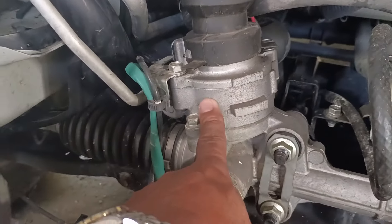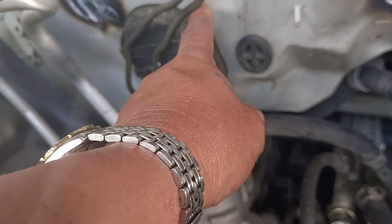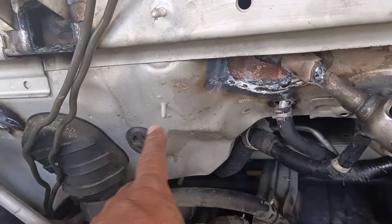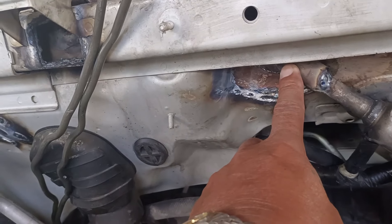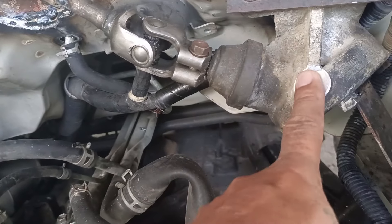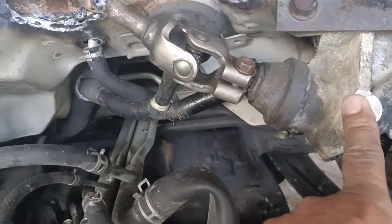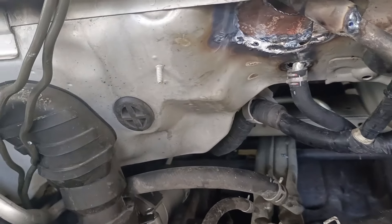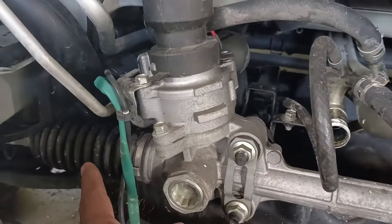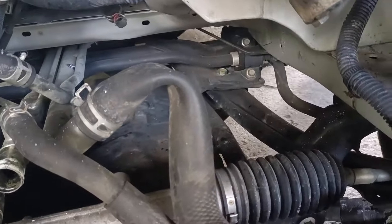So from the right-hand drive, a secondary gearbox was added inside. There's the connection here. We'll look inside now so you can see this connection. Inside, there's one secondary gearbox going out to the exterior — another secondary gearbox going to the left-hand drive. This conversion is complete — this is what's called 'baki-baki.' The original rack and pinion is still there, untouched, so its function is still okay.